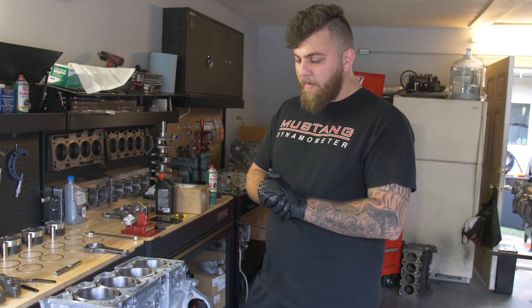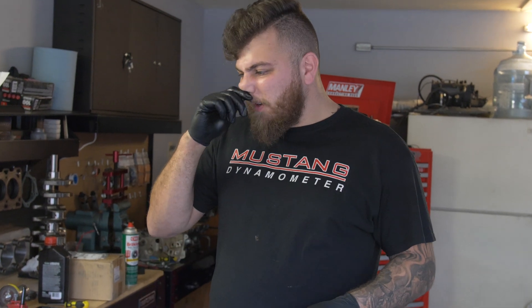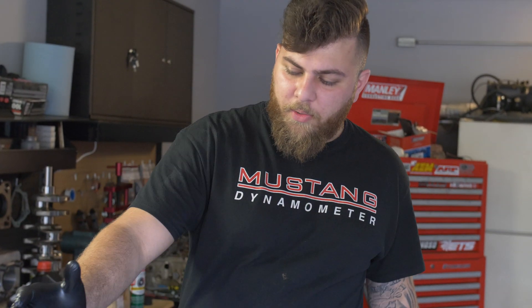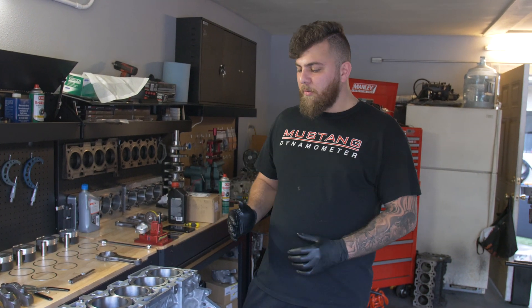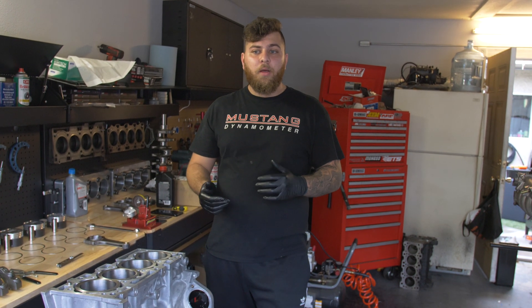That protrusion acts like a glorified O-ring, basically making a better seal on the head gasket from the combustion chamber. The other difference is the 4B11 has four-bolt main caps, while the 4G63 has a two-bolt main girdle that ties everything together — which is very strong, but the 4B11 is just as strong, just not tied together. On every block we do, we align hone the main bores with ARP main studs to make sure they're a true, perfect circle and all straight, so the crankshaft moves in and out freely with no steps between the main tunnels.